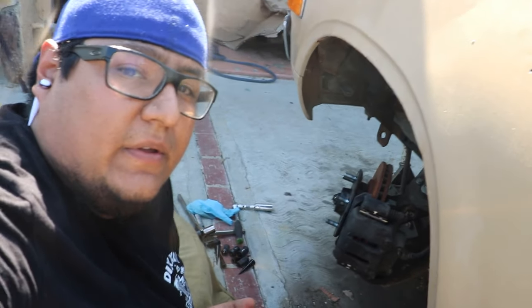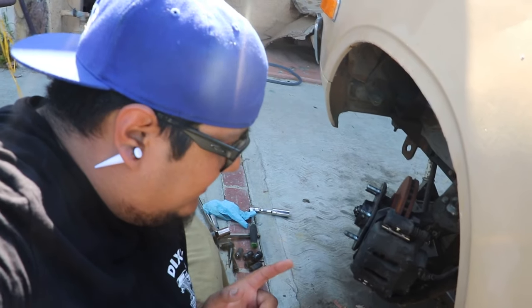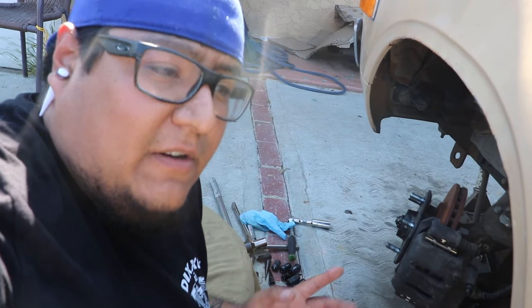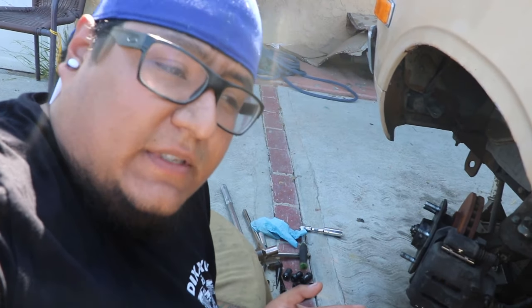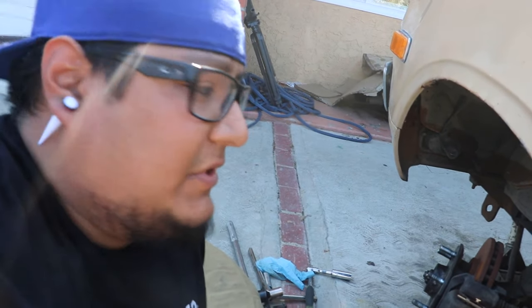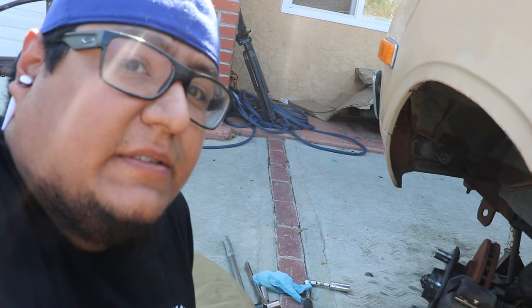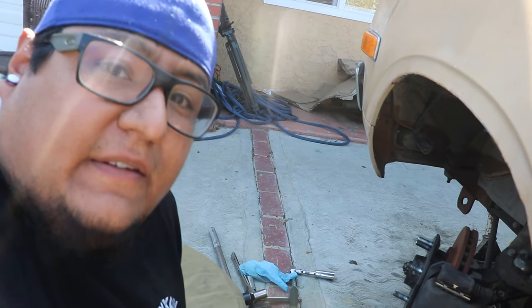So for kingpins, you need to get your upper control arms, lower control arms, the spindle, brakes, rotors, caliper bracket, brake pads, and hardware kit. Simple setup. Or you can just buy the disc brake conversion kit, which means you can keep your kingpin setup but turn it into disc brakes.